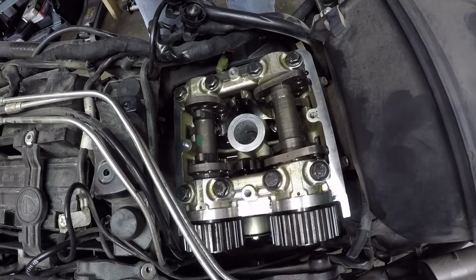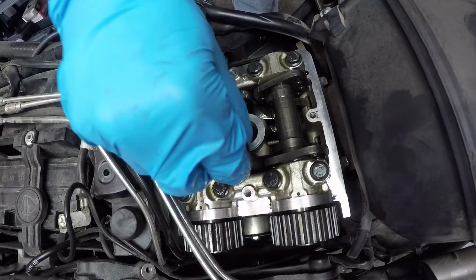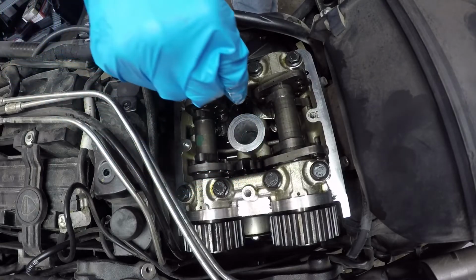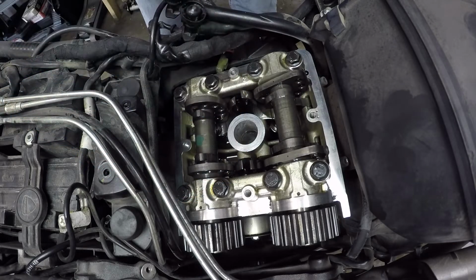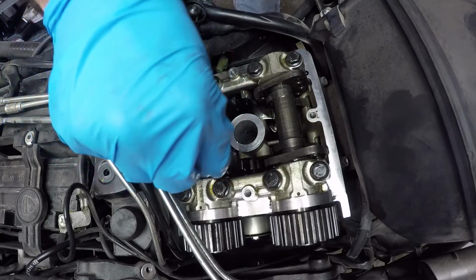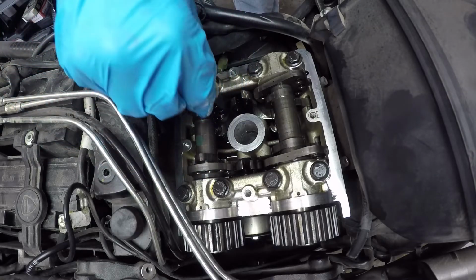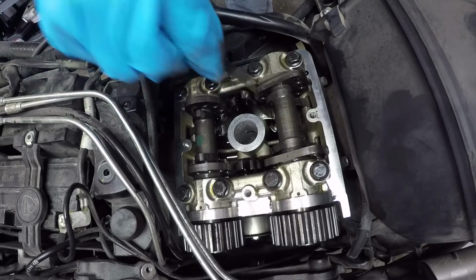We'll start off with 0.05 millimeters, because that is the lower end of the specification. That closer is okay. That closer is okay. That closer is okay as well. Now we'll go to the upper end of the clearance specification to make sure something isn't too loose. The upper end for the closer is 0.10. Doesn't fit through there. Doesn't fit through there. It does fit through there, but there is a slight amount of drag, so it's probably okay. It does not fit through there. So three of these closers are all right.